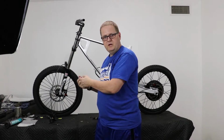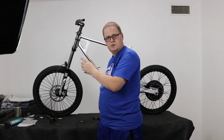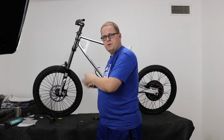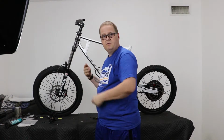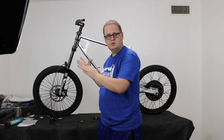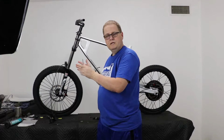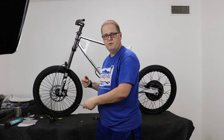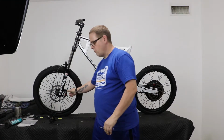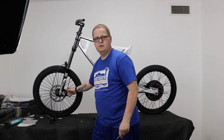Determine the thickness that you need in order to clear that, because what you're going to do is compress the brakes and then tighten them up, remove the material that's spacing it off, and then spin the wheel to make sure it spins freely, and then engage the brake to make sure that it engages fully on both sides, and then releases and continues to spin freely. This may take a little more adjustment as you go. This is all kind of fine-tuning stuff.